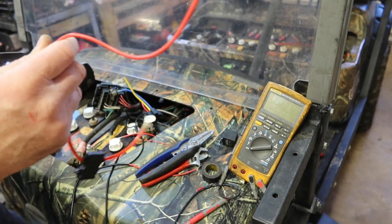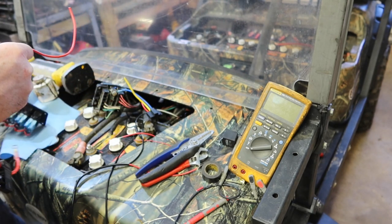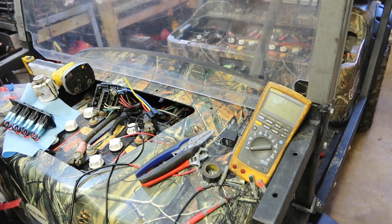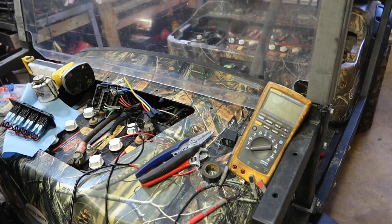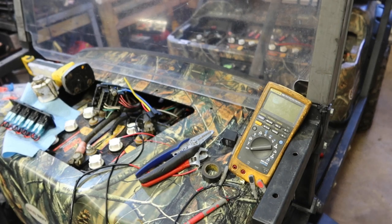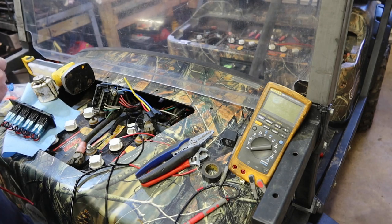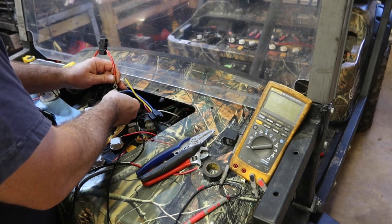And like I said, I put a 10 amp fuse in there and I might need a 15 amp fuse, because if I did all of them, it would be probably pretty close. Yeah, let's go ahead and put a 15 amp fuse in there. Because when we added it up, I want to say our very first light had, what, 4 amps? Probably another two, so a total of 8 amps. And then the ground effects lights, I would say I'm bordering on 10 amps. But realistically, it probably won't ever hit it. But if something catastrophic happens, like a wire shorts out or whatever else, the fuse is there to protect the circuit. So you want it to be about 20% spare capacity or more, right?